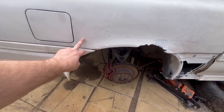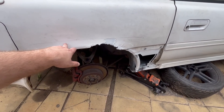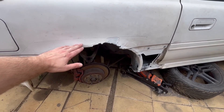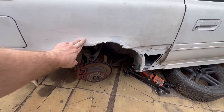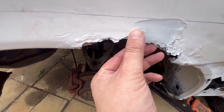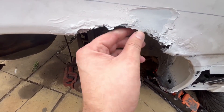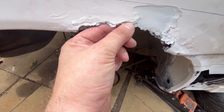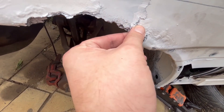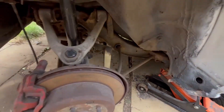The reason we sketched out here is this is where the repair panel is going to come to. We've got the outer skin and a bit of the inner skin, but we're probably going to have to take it further up into here as well. As you can see, down here is the outer skin where my finger is, and that's the inner — and there is some inner left, but it is sort of going through, so yeah, that's that section.